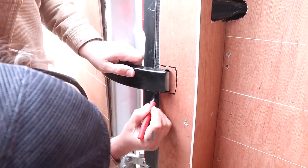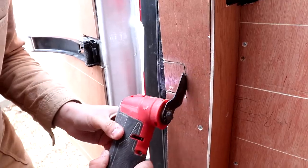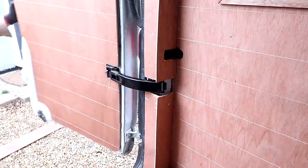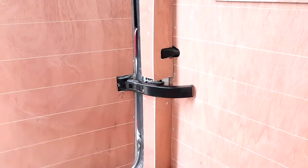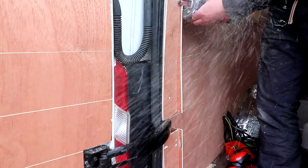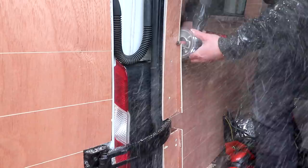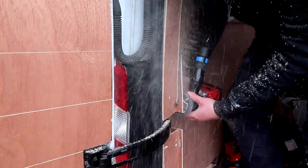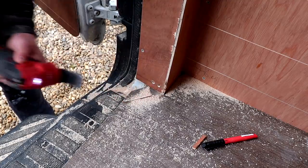For the door holder brackets, we originally were going to make a small cutout for them, but we realised that if the wind caught the door the brackets would probably break through the plywood. So we ended up cutting it all away to allow them to open and close fully — it didn't look great, but this will all be hidden by cabinetry later anyway. Next we flush trimmed the edges of the ply using a flush trim bit in the router. It's a bearing-guided bit, allowing the bit to cut to the contour of the inner panel, and we finished off the hard-to-reach areas with the multi-tool.